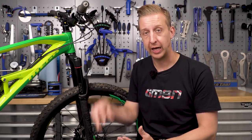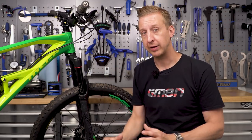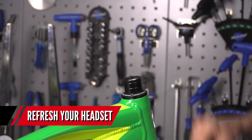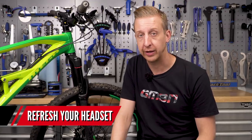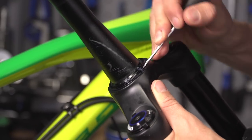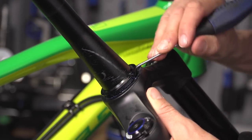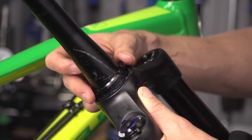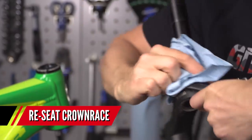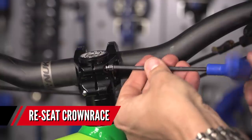The other main thing at the front of the bike is the headset — the bearing that the fork spins in, onto which the handlebars clamp via the stem. There's a lot of force going through this, so if it's dry, gritty, or even slightly loose, all of these can affect it. It's easy to just take your stem off, inspect the bearings inside, put some fresh grease in if necessary, and take a look at the crown race on the steerer tube, because that can work loose. These days they often involve a split ring that can move, and the tiniest amount of movement can develop into a creak. Give it a good clean, put a little grease on there, reinstall it, and adjust your headset as necessary.